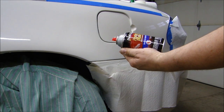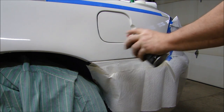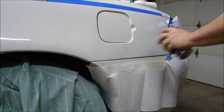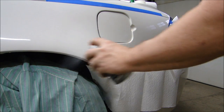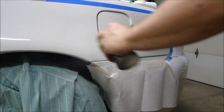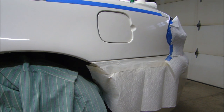I'm using standard Duplicolor spray can — you don't need a big spray gun to get good results for a repair like this. Since it's white and I used gray primer, you should put a couple of coats on to get the color to match, because the primer will show through. One nice clean coat and there you have it — repair using lead, no Bondo, and no chance of bubbling up like the last repair.